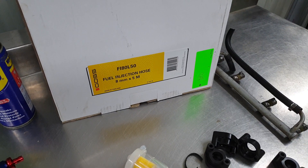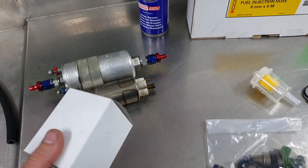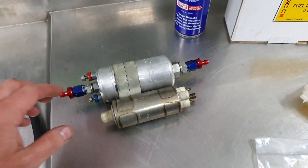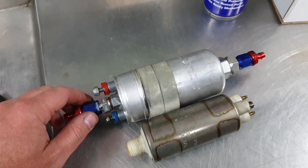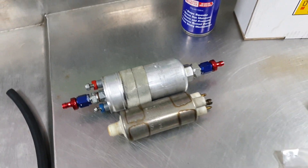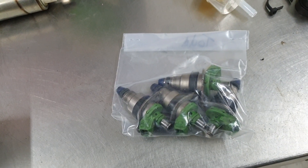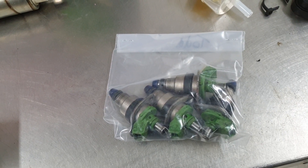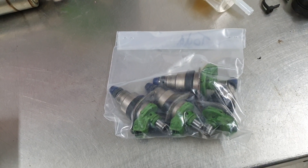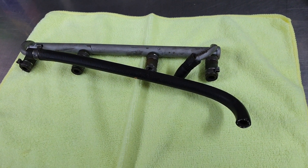For today I've got the new fuel on: pre-filter before the fuel pump, after the fuel pump high pressure filter. This is the original fuel pump which is dead, so I'm going to borrow the one off our turbo drag bike so I can be up and running. I had the injectors cleaned — they said they were stuck shut, so there's no way the bike was going to run. So Trent from Bunbury Fuel Injection serviced those, so thanks for that.